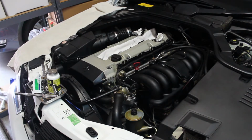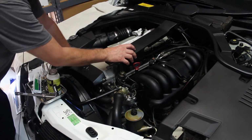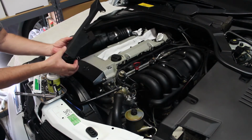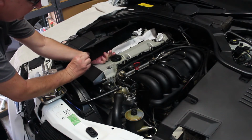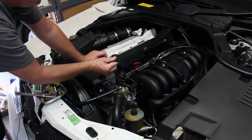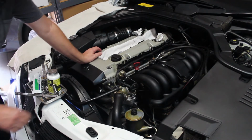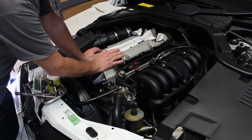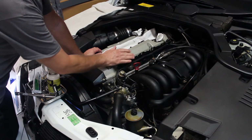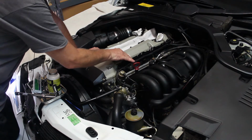Then I wanted to look and see if the wiring harness had been changed. So I took this cover off. It actually goes this way. To do that, I put a piece of plastic underneath here and pushed up, and these unclipped. Then the whole thing flipped up like this, and I was able to pull it loose from its hinges. So that part's ready to go back in. I've cleaned it up, and the good news is all the wiring has been replaced. It's not the old rotted biodegradable wiring that I was worried about it having. So that's good news. I'll put that back together here.